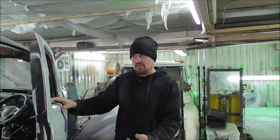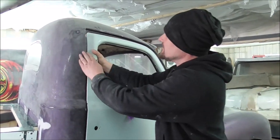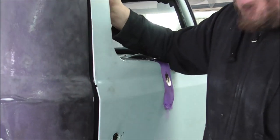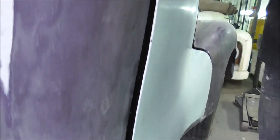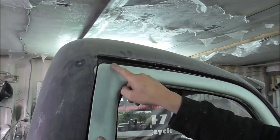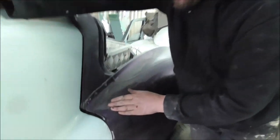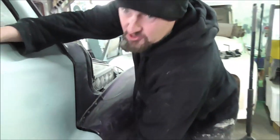Another thing with this door is that when it shuts, it's nice and flush for about the first 30mm, and then it just goes off — just unbelievably bad. Up the A pillar it's a little bit tight, but then it gets way slacker up here. Look at this gap. And just here, there's barely any relation between the shape of the door and the wing — all this should be in one flat plane. So there's definitely work to be done on the door.